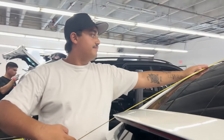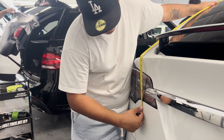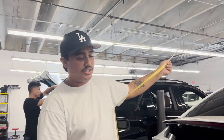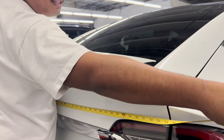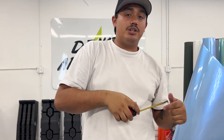Now I'm measuring out my trunk — just the top part — and that's going to be a little over 4.3 feet. I'll give it some extra room because there's a curvature. My length is also five feet, so we'll have a four-and-a-half-by-five-foot trunk piece. Even though my trunk is only 4.3 by 5 feet, I'm going to cut out a 5 by 5 so I have enough excess material to wrap the wing with it. Let me show you how to cut it right now.